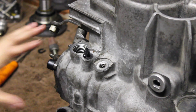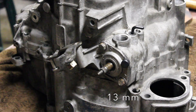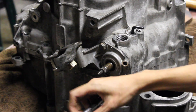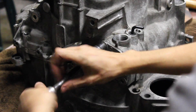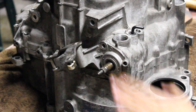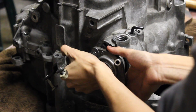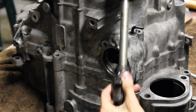Now I'm going to flip it again — you're going to take off two more screws on this side to give you access to taking out the shift fork. There's a little cap right here you can take off, and these two 13mm bolts. Take those off and you're done as far as being able to lift the case up. Pull the shift fork out just like so and it comes right off — and here you can see how the gears actually engage, reverse, all that kind of stuff. It's pretty neat.